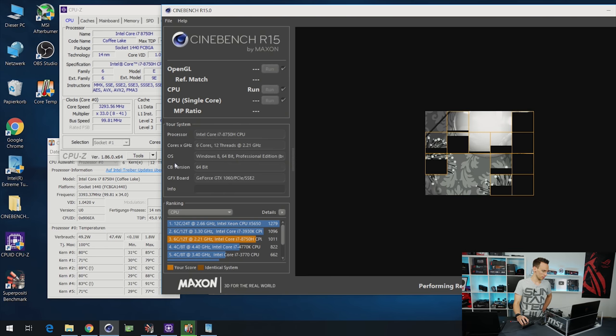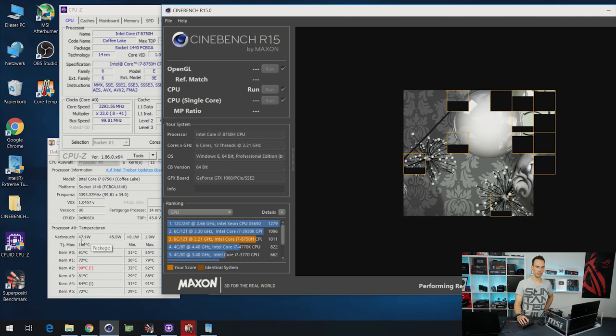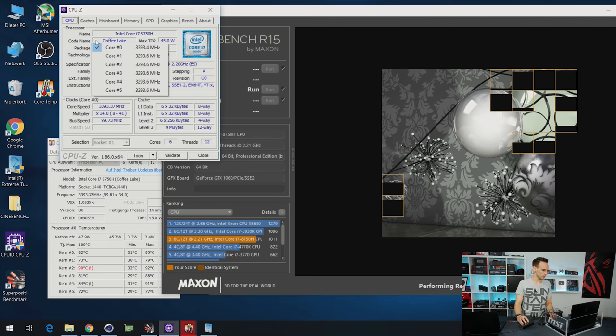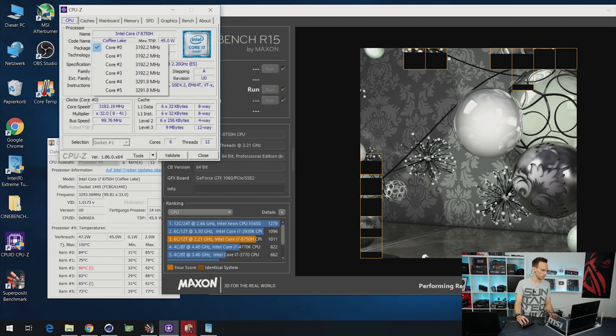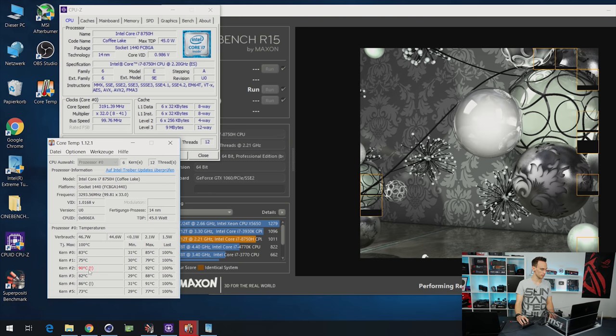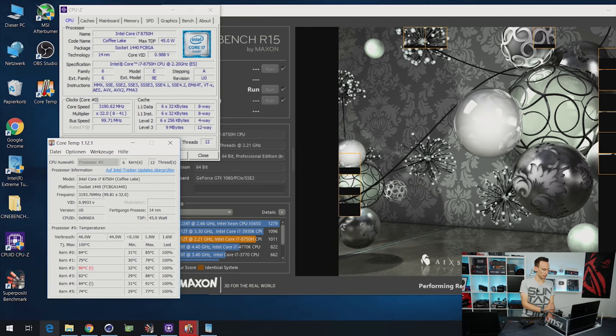Oh yeah, CPU is getting much warmer. It's also consuming more power. So we now have 47 watt. Previously it was 32 watt max. If we check the clocks, it's now 3.3 peak, I would say. It's not that much higher than keeping the turbo stock, but we can also see that the CPU is still hitting the temperature limit at one core, so still 90 degrees Celsius on one core. I thought it would be lower than that. Expected more from the Novec.